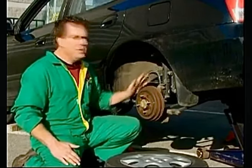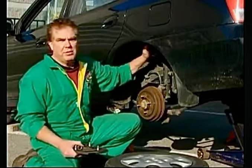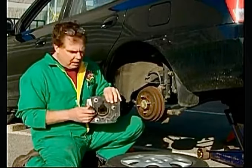And when you lift the vehicle up and you look under there, you may not see anything that looks out of place, worn, or damaged. But when you go to the top end of the strut and remove the strut from the vehicle, you'll see the problem. Now, the strut on this Elantra is still in there. There's nothing wrong with it. We're just using it for a frame of reference. But there's an example of one of these upper strut mounts that wore out.